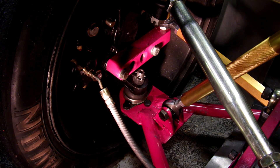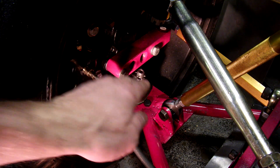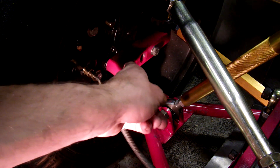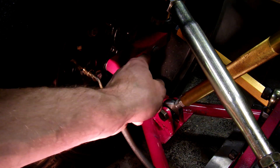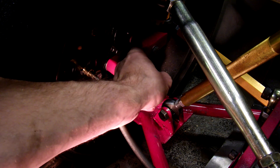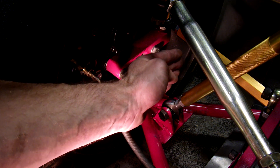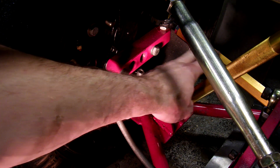Thinking about the different ways of doing it, at some point I'm going to get some custom arms made — machined up — that are going to come out like this. But for now I'm going to put spacers between here and the spindle and just move that over, and I'll put shorter arms on. I happen to have the shorter steering arms, so that's fine.